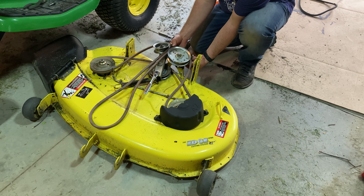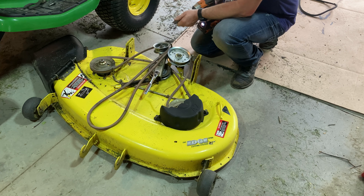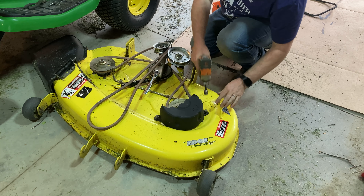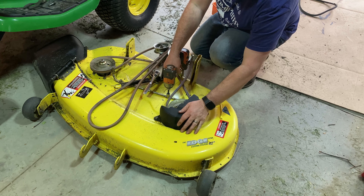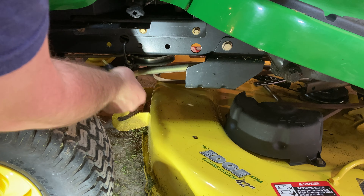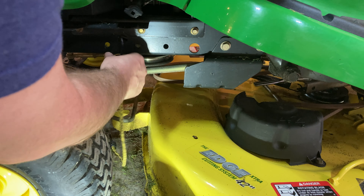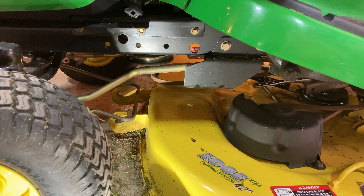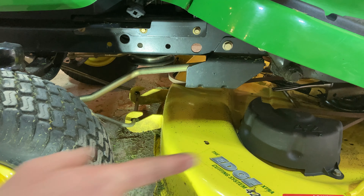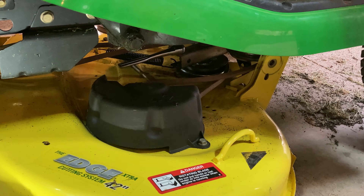While we have this out, it's a good idea to give some pumps of grease to this point. The grease I'm using — I'll put an Amazon affiliate link below — this is John Deere brand TY6341. This same grease I use on all the Zerk service points of my John Deere 2210. Go ahead and use our gun to tighten all these points that we had loosened, making sure we're staying in those notches in both spots. These belts are close but not touching. Switch back to 13 millimeters and put our cover back on.